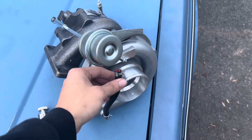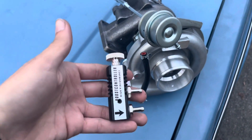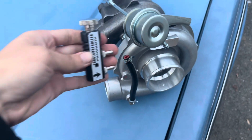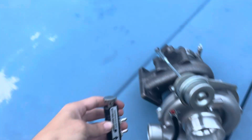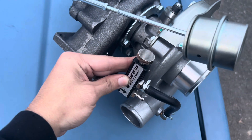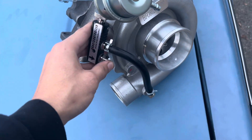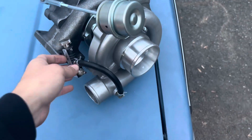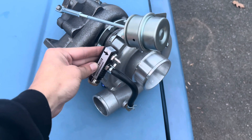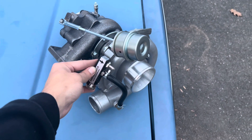When I clocked the turbo, the original hose that went from boost pressure to the wastegate was a little bit too short, and I found that as the perfect opportunity to throw this really cheap boost controller right in line. What we're going to do today is install it — not on the inner fender like most people do — we're going to route it to the controller, make a bracket so it sits right about here, mounts onto one of the bolts on the back of the turbo, and then it'll be routed from this spout up to the wastegate. Super simple install, super simple bracket to make — about a 90 degree — and then that's a wrap. Let's start making that bracket and getting this thing mounted.